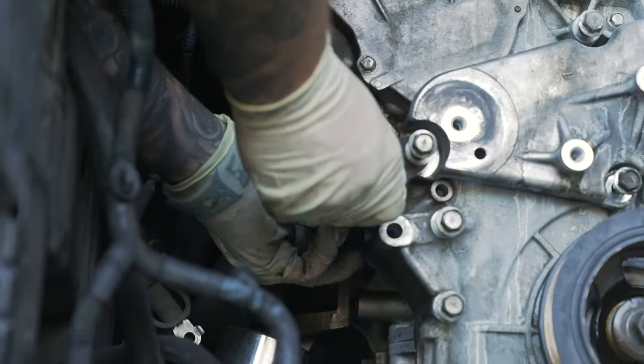Since it was an actual gasket that came off, it didn't leave any material behind that's going to give you a leak. Got a new gasket for it. The tape I used to redirect the coolant — I got a couple little drips here, but before I started doing this method it would be completely soaked in there. So now I know the coolant didn't go up into the girdle, didn't go behind the oil pump — that's kind of why I do this, to keep about 98% of the coolant out.